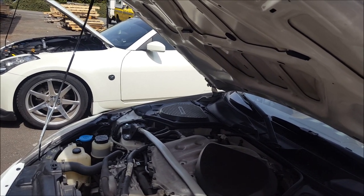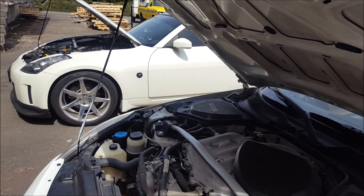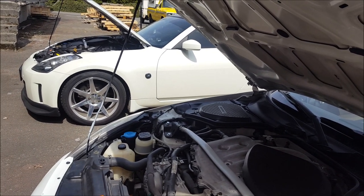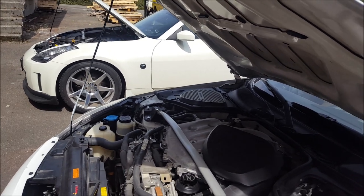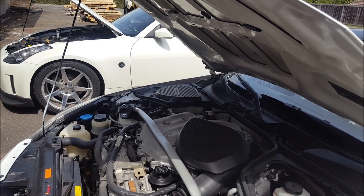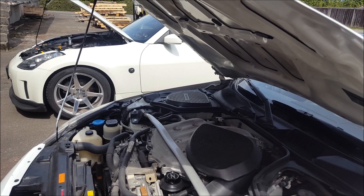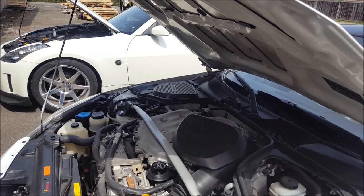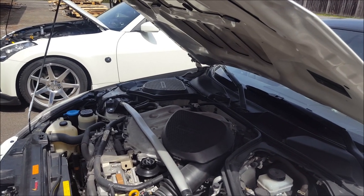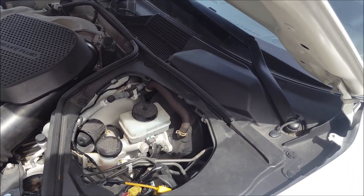I'd sit in a lot of other vehicles and they would feel great, and this particular car, for being a sports car, it doesn't feel as good as it should. I was actually on Z1Motorsports.com just looking for stuff for my car and I came across a particular mod, and it made so much sense. In the description it even says to look at your brake booster when you're doing a brake application, because the firewall in these cars is actually thin and the booster moves.